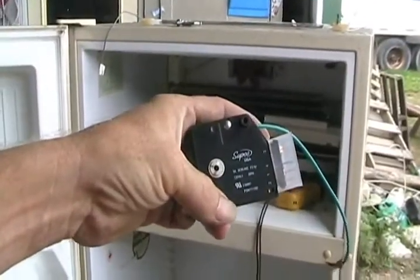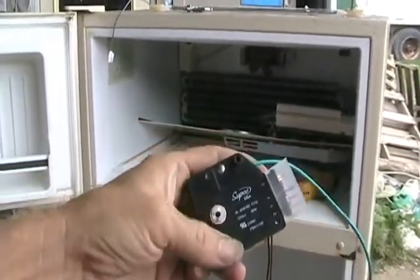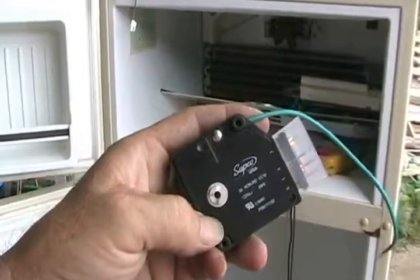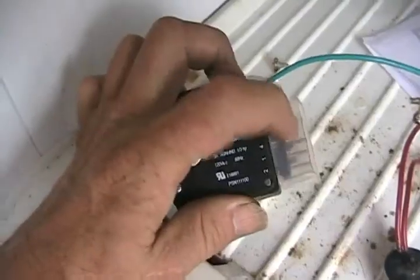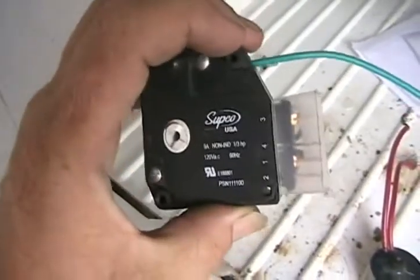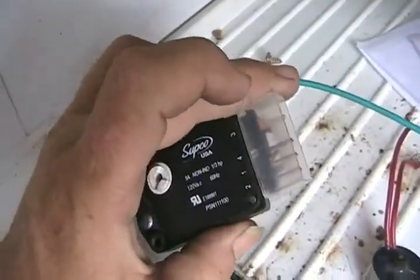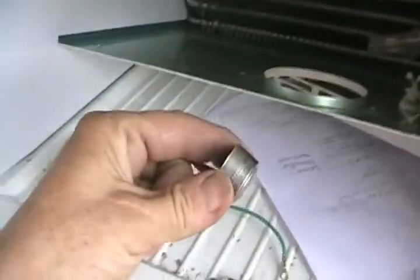So my very first test on a fridge that I assume has a defrosting problem is: I find the timer, and without paying attention to whether it started running or not, I just rotate the dial with a flat screwdriver until it goes click and shuts the compressor off — putting it on the defrosting cycle. Then I unplug it from its plastic connector, plug it back in and out a few times, and look for a big spark on one of these terminals. If you don't see a big blue spark, that means either the heating coil has burned out or this thermostat is burned out.